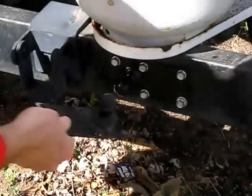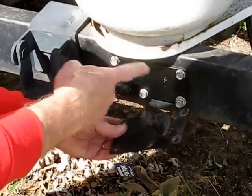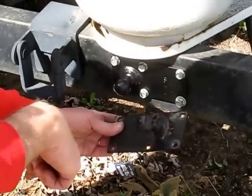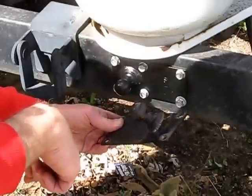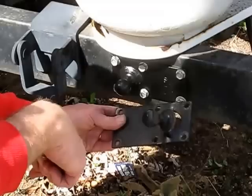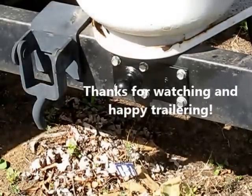A couple of things I want to mention about this control. This can happen under a couple of different conditions: if you tighten it down too tight so it doesn't have enough free play, you can pull the ball right off. Or if you operate it in reverse, you can also damage it. Whenever you're backing up, always take off the sway control. These are about $20 — if you have to replace them, they're readily available, so it's not a huge deal. To prevent the extra work and expense, just don't tighten it too much.